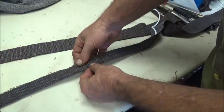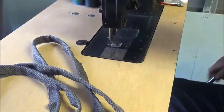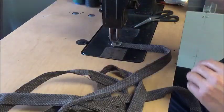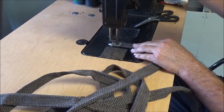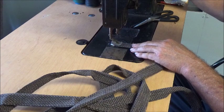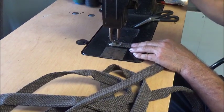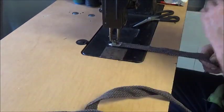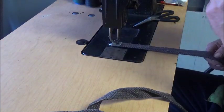That's how we're going to sew it — the best way I know to make a transition so you can't really see it. I'm still using my old motor; I don't have my new one on yet. To get a lock stitch on this one, since you can't reverse it, I bring the needle down, then bring it up, lift the presser foot, bring it back, and go right back in where I was to lock it. This is not a walking foot machine — it is a walking needle machine. You'll see the foot stays stationary; the needle actually moves.